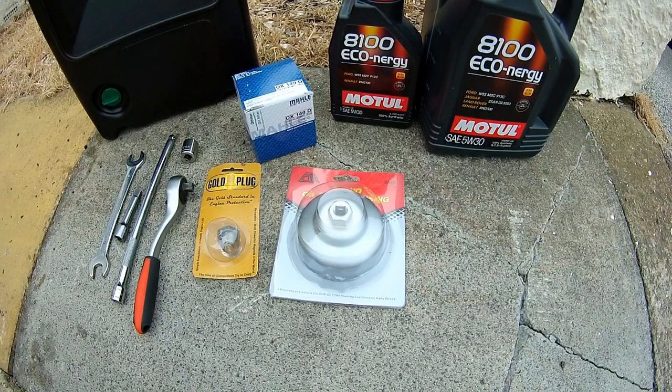I got 5W30, an oil wrench tool to be able to move the oil filter, an oil filter, a sump plug with a washer, but I've got a magnetic one, and an oil pan to obviously get the oil from the sump. I'll put links in the description of where I've got the products and everything. You also need a ratchet and a spanner, but you can probably get away with just a spanner. I'll give more of the size when we go in to actually remove the bolt.